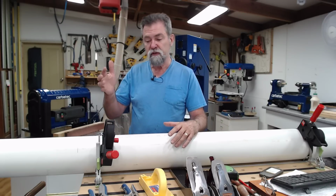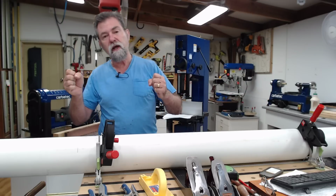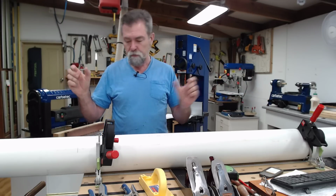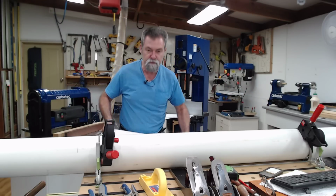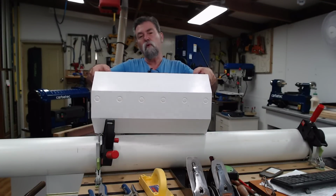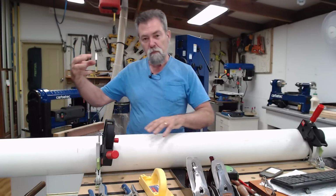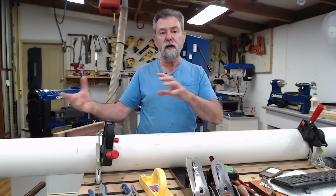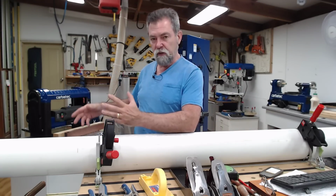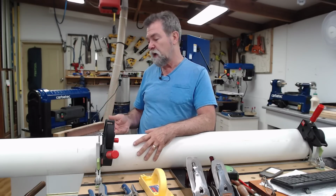And I will have it so that this silencer will slide on around about 2 inches onto each section of pipe, which is around 50 millimeters both sides. So you'll see I'll have a good 400 millimeters available for muffling. And I'll be able to slide it out and give it a tap and clean it if it needs it. So I'm trying to think ahead to all the problems that I might encounter.